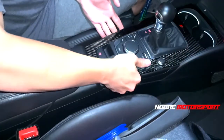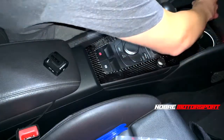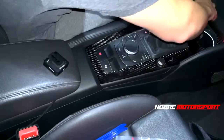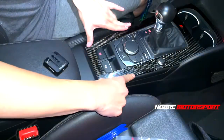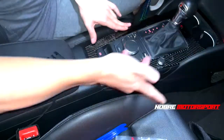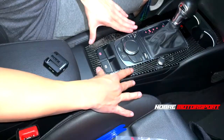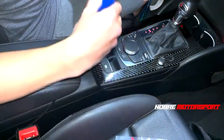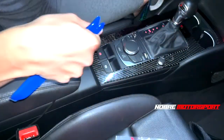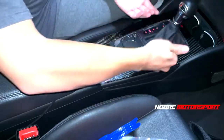The console is already attached and won't come out anymore. Now we just need to put this original rubber finish here on the front - and that's it, the center console is fitted. To recap: two plastic keys fit here on the back, pull it up and it lifts the console. Then you pull the console up and back to remove it. Loosen all the wiring and loosen the gearbox trim part, turn it around, and put it aside.